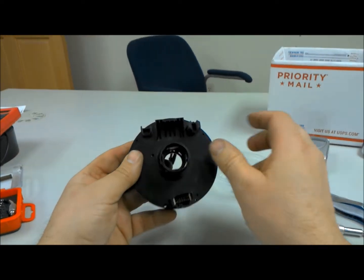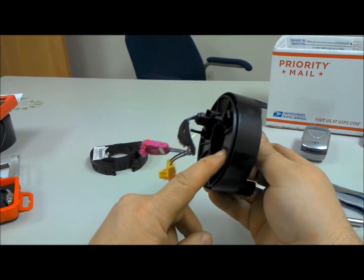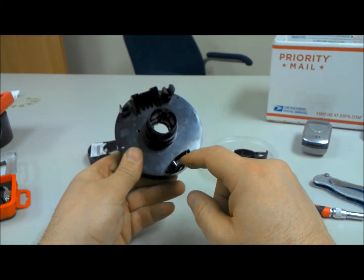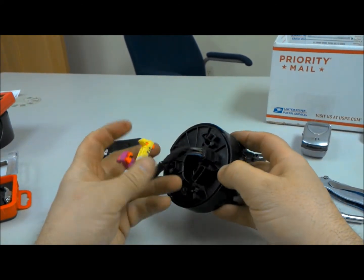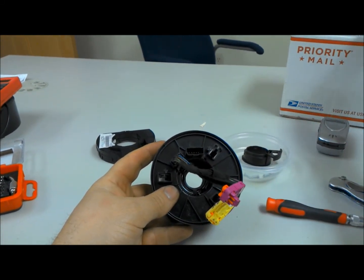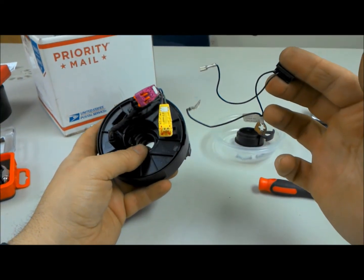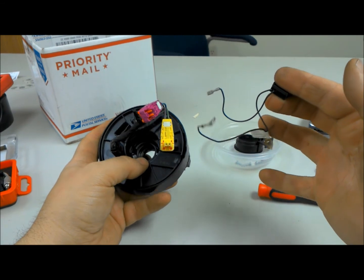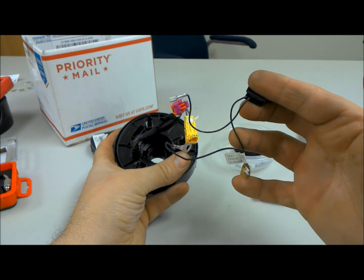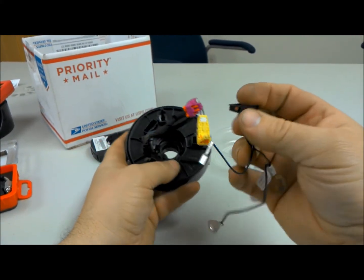What we want to do is look inside of here. Now this has a ribbon cable in it, and this piece here is responsible for maintaining the electrical connection from here through to these wires here, and also through that wiring harness that goes in there. This is the connector for your horn wire — you see you've got a ground lug, and this fastens on a wire. It runs in behind your airbag module, and when it touches the steering wheel it grounds it out.